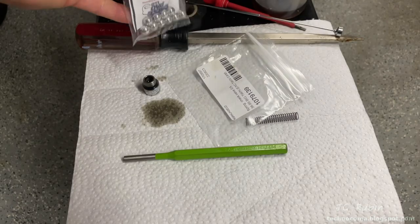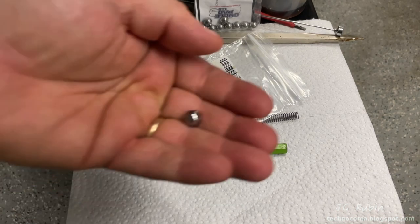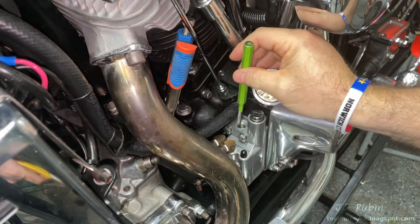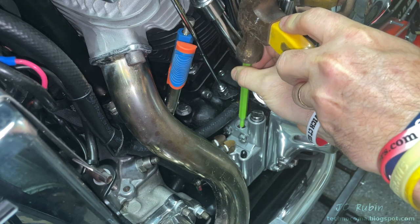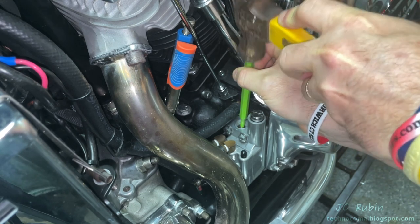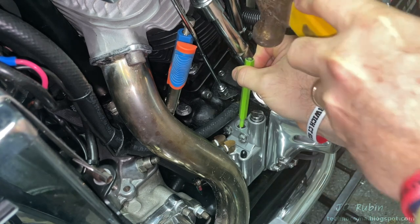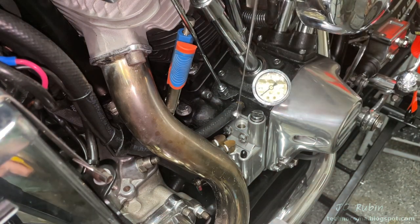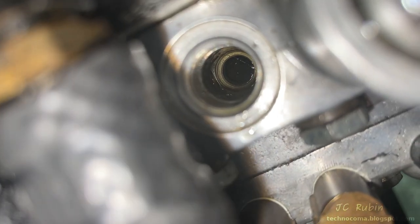Cleaned up around the area and took a good look at the seat. I've got my drift and a pack of 10 check valve balls. We're actually going to need two of these. I drop the first one right into the oil pump, place the drift squarely over the ball bearing, and with the hammer gently tap the top of the drift to seat it around the seat and fix any imperfections. I reseat the drift, center it, and do another round. This first bearing is no good since I hit it with the drift, so I use the magnet to pull it back out.